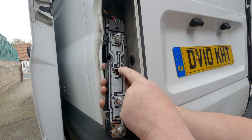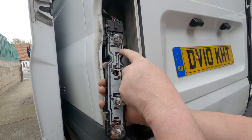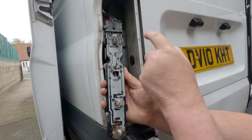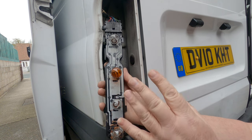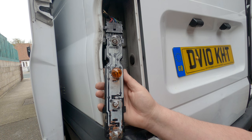It's a bit rusty — I've cleaned that up before putting it back together. The indicator wire is the second one in, which is grey with an orange stripe, so I'm going to connect to grey with orange stripe. When I've connected that wire I'll confirm it with a test light, just to make sure I haven't done the wrong thing.